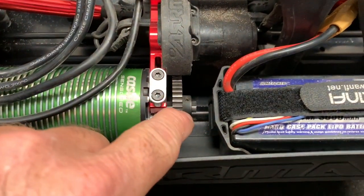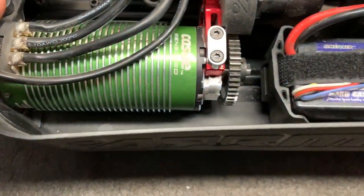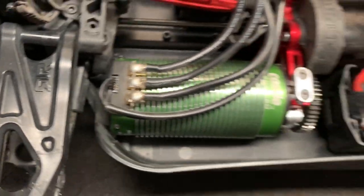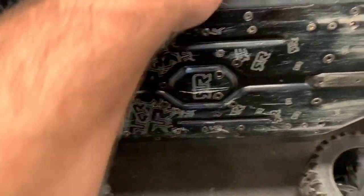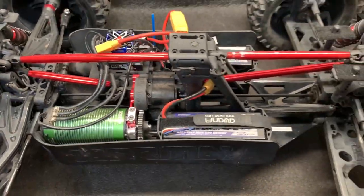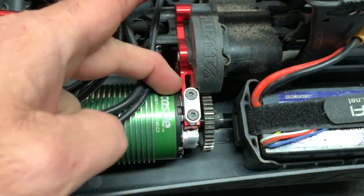Here it is in the truck. Seems to feel okay. Now, one thing is, this is all the way out. This is using the PPS mount. All the way out, the motor is up against over here. Got a little piece of grass stuck in there. I wasn't able to get that bolt in place — you can see how it's got that pushed out. So if I like this speed, I guess I'll try something else. Maybe a smaller spur, and then I can use a smaller pinion.